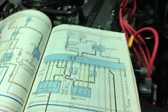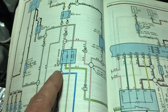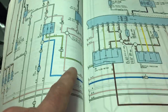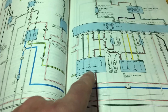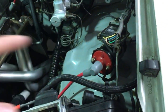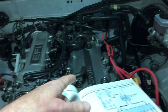If you're having problems with the circuit opening relay not working but you've eliminated the relay as a possible source of problems, then start looking to see if that little switch inside the airflow meter is working. Also check to see if you have continuity to ground from E1, which is pin number 2, back to some ground on the chassis and or the motor.